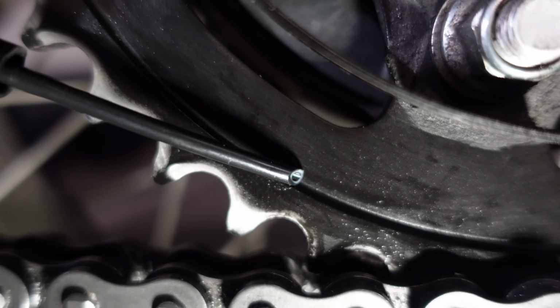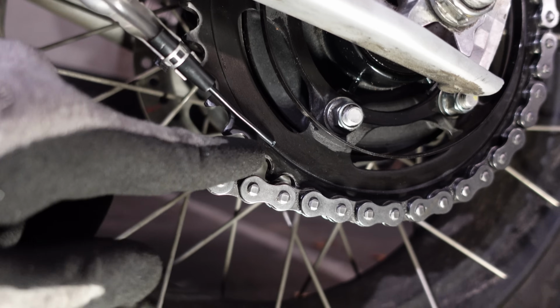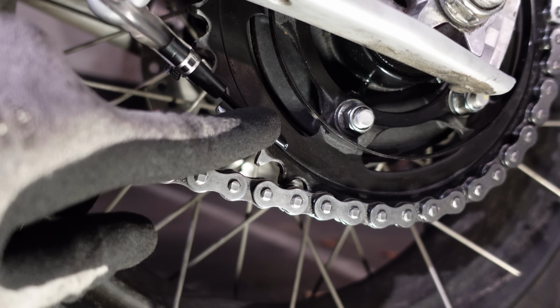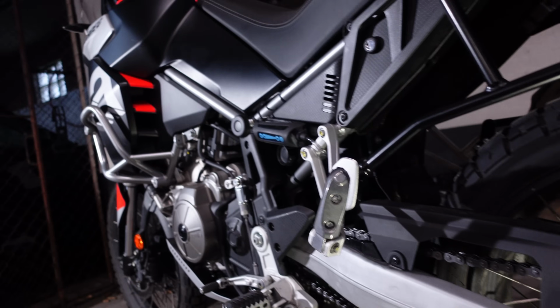That helps to get a better feed onto the sprocket and also avoids a problem that I had in Norway last year, whereby you have the bracket putting too much pressure onto the sprocket without that point only touching it. The pressure causes the nozzle to actually melt itself shut as it rubs on the sprocket. So yeah, just a tiny, tiny little touch and point first.